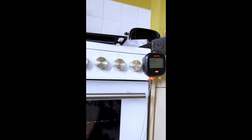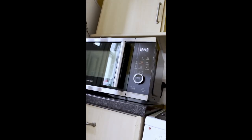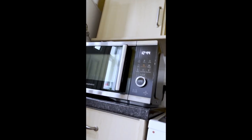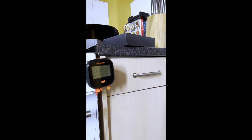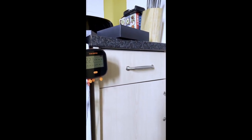But this grill does not go red, as you saw from the test in the microwave. My microwave grill went red after 5 minutes, 4 minutes. It was bright red, glowing bright red. This grill stays black. It just does not glow. It's as if the switch isn't working to tell it to turn on to grill.